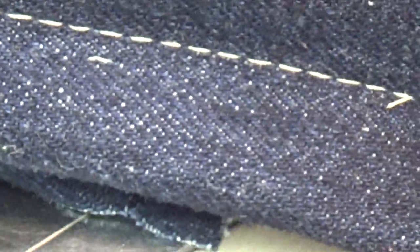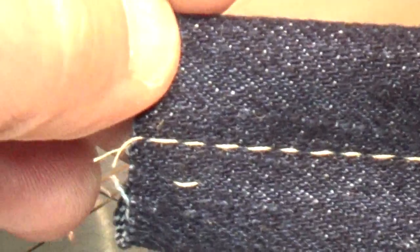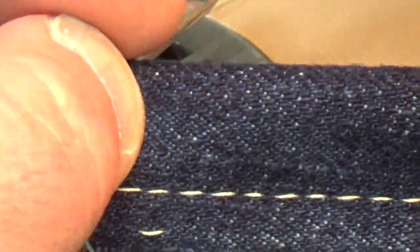So, beautiful stitching, four layers of heavy grade denim. We turn it to the side, you can see what we just went through. We turn it the rest of the way over. I'm going to flip it here. Now we're looking at that lock stitch, and there's just no difference. That lock stitch from start to finish is absolutely spot on. The spacing, the formation, the integrity of the stitch, exactly as we want to see it, just like the top stitch.